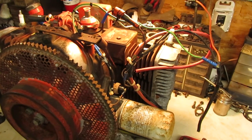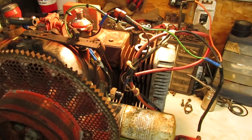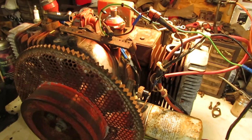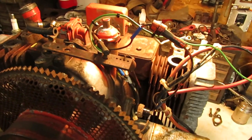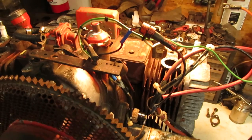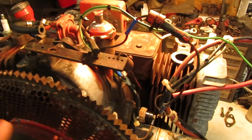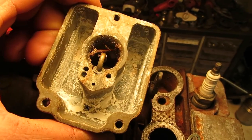The other night I got the heads and cylinders and everything cleaned up. I did a redneck valve job on it — ran the wire brush around the underside of the valve and got the seats cleaned up enough where everything will seat nicely. After I cleaned off the top of the pistons, I found this engine was rebuilt and bored to 20 over at some point. Everything's back together using the old head gaskets since I don't have extras. If I roll this over it does have pretty darn good compression now. Onto the carburetor — I got all the water dried out of it too. You can see it's just a bunch of flaky crusty white stuff, leftover corrosion and old gas. We'll blow that out in the glass bead blaster.